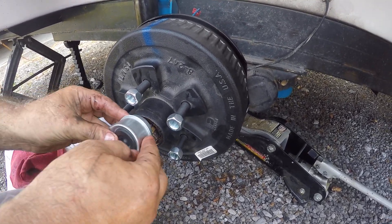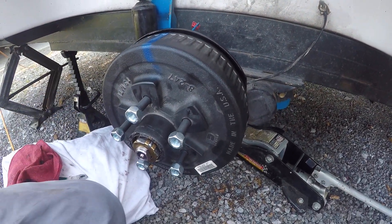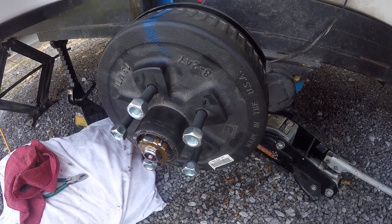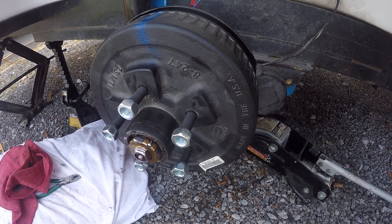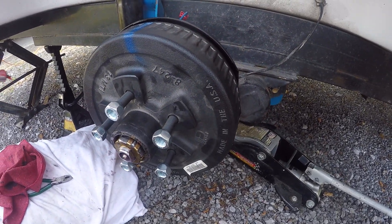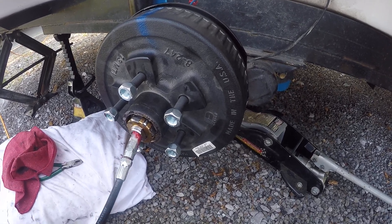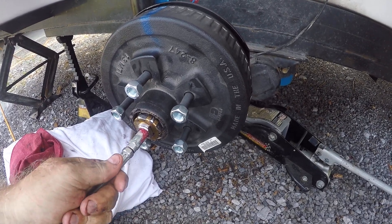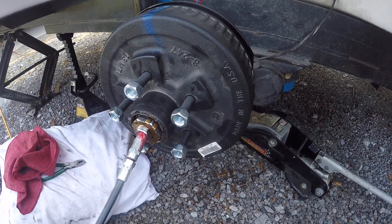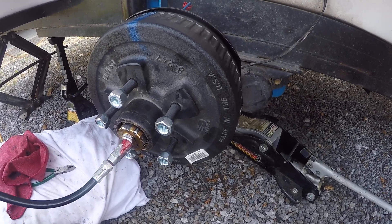The only other thing left to do is put your dust cap on. These are easy lubes, so I'm going to get my grease gun. I'm using high-temperature grease. What we're going to do is there's an orifice in there, and as you pump the grease in, that orifice is pumping the grease back and it's going to come out at the seal. When we reach that point, I'm going to stop. We want to pump that grease through.